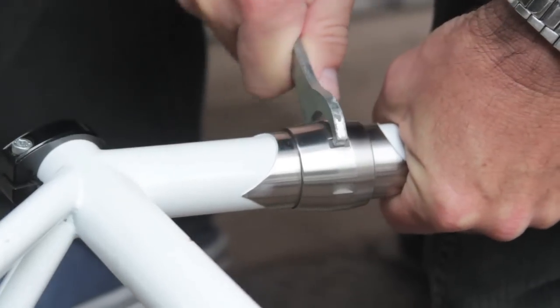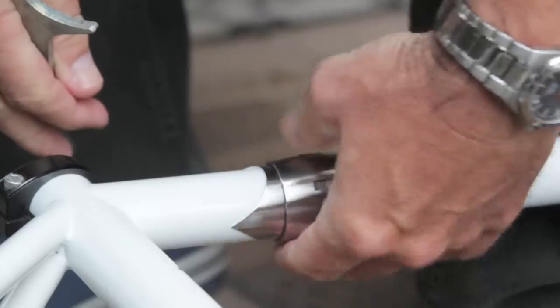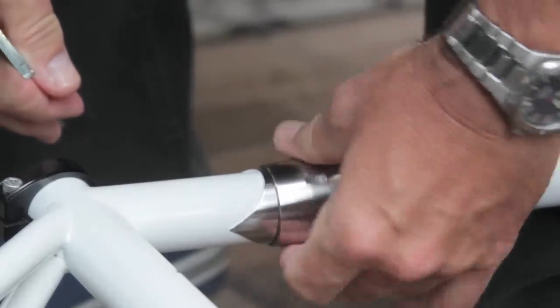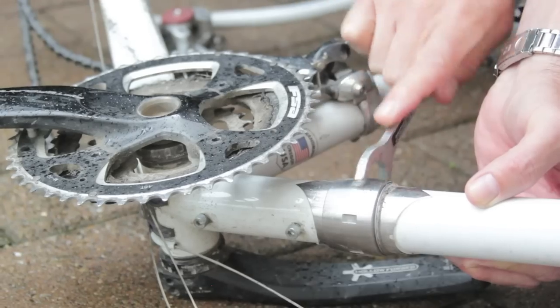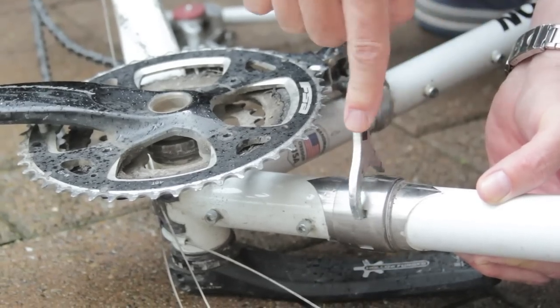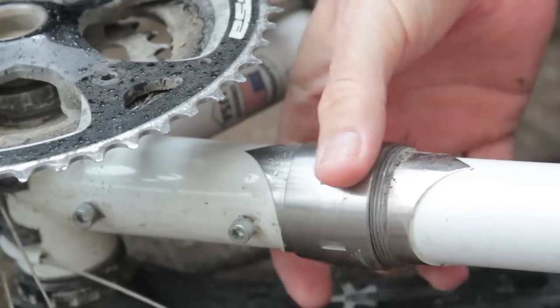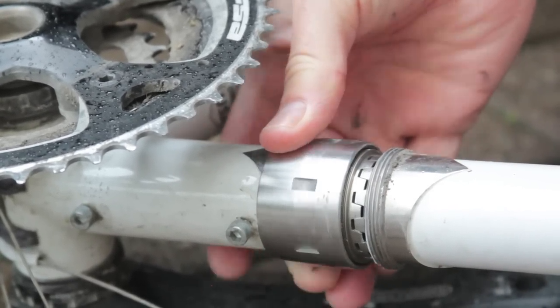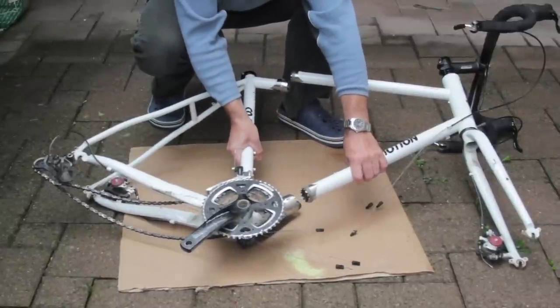After that, use the S&S coupler wrench, which is included with your Co-Motion bicycle, to carefully split the frame of the bike in half. Just twist the coupler's outer casing in a counterclockwise fashion, and the bicycle will easily split apart. Depending on the size of your bicycle, you may also need to remove your bicycle's rear derailleur and/or the front fork from the rest of the frame.